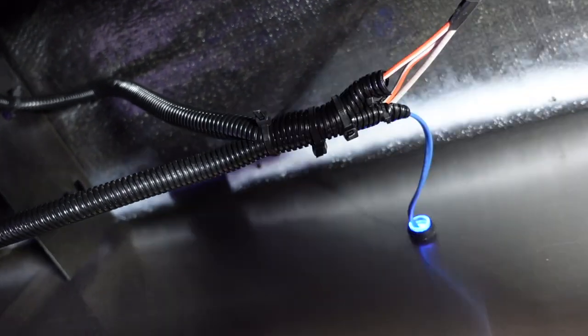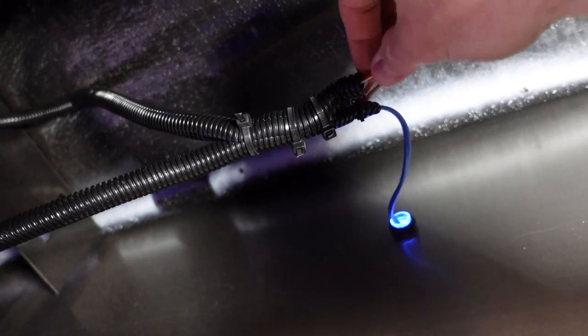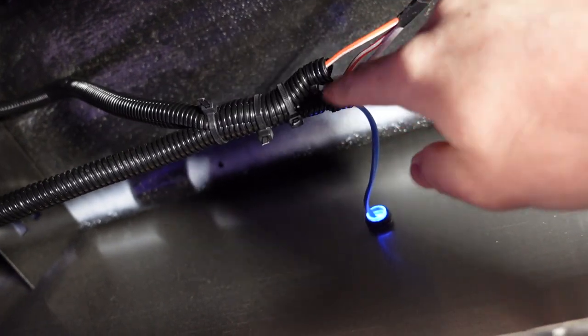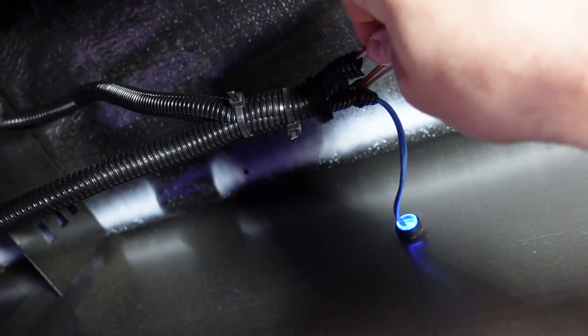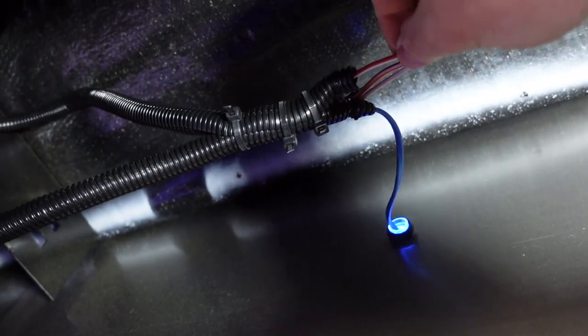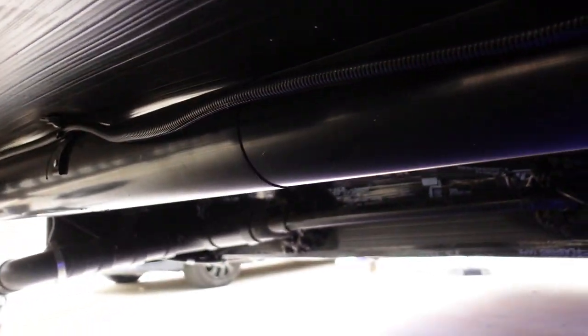That was the first step. Next I had to send power to awning number one, since I had cut it from this bundle. So awning one has no power and I've got to feed it 12-volt. I ran a single strand of 16-gauge wire from awning number one, going into the wire loom up here and coming down following the same path as the wire that runs to the other blue LED, except it goes back inside. I wanted to go inside the I-beam.